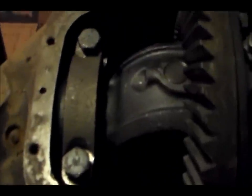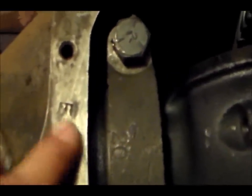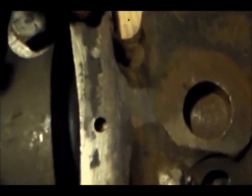Here is the inside of our differential, here are our carrier bearing caps, and here are the four bolts that I just loosened. What we want to do is stamp a number or a mark indicating which end is which. On this axle, it's very important — when this axle was manufactured, these caps were machined for this side. Somebody else had this apart because over here I can see an E facing down, and stamped on the other side is also an E facing down.